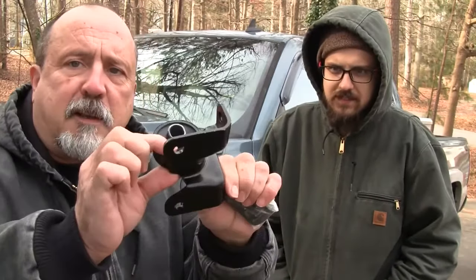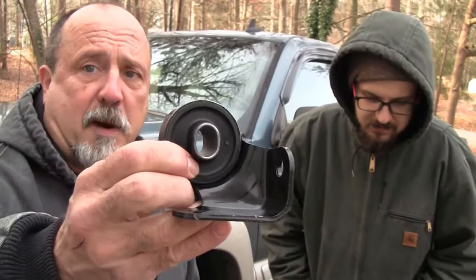So Joey Silverado has been making a strange thumping noise, and it was driving both of us crazy. So finally Joey crawled underneath this thing and went through it head to toe and found what the problem was. What we found is that the bushing for the torsion bar crossbar, see if I can spit that out, was completely gone, and the bolt that holds the torsion bar crossbar was bouncing up and down, making a hellacious racket.